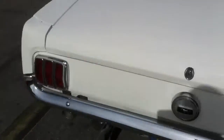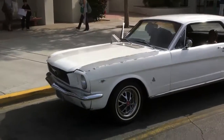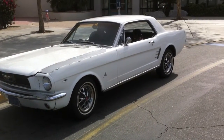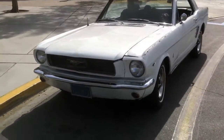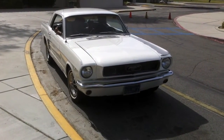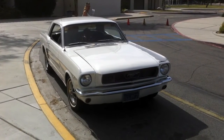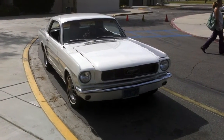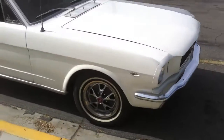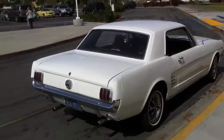Kids are picked up — a little late because we had to do a lot of fluids. There she is, out on the road again after about a month and a half of working on this car — 50 days. It's always a pleasure to take a car out and run her. She's been idling while Carlos was in the car, no overheating, staying right in the center. We are good to go with the fan relay, new radiator — no leaks at all on any hoses that I can see. We'll run her again in about an hour or two and look underneath for anything leaking. Rims are all cleaned up, underbody exhaust is fixed, no more exhaust leaks.